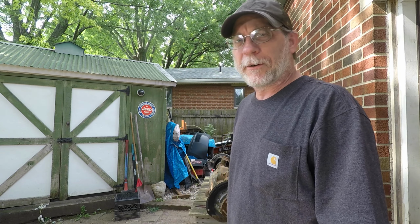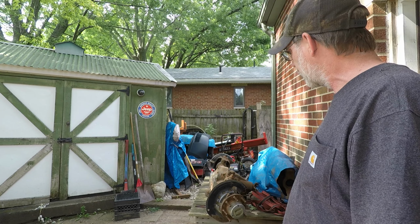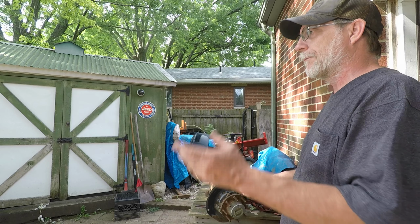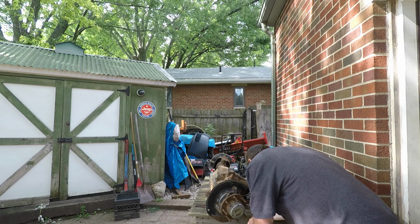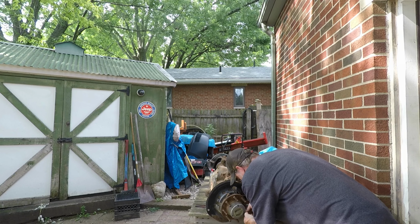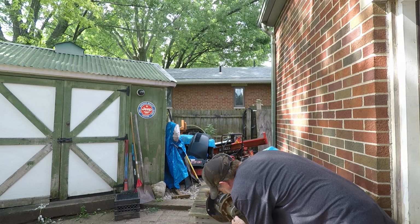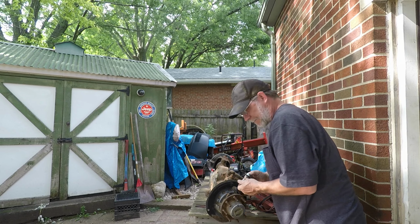Okay, I think it's the ball joints that are hung up. I do got it kind of straight. I filled it with some penetrating lube. We'll let it soak. Meanwhile, we'll work on this side. Need to get the, good grief, the locking hub out of it. All right. Just T25 Torx. Loosen it up.